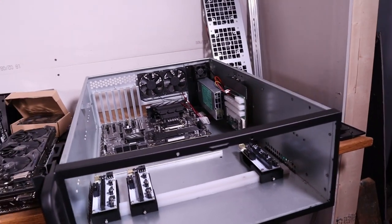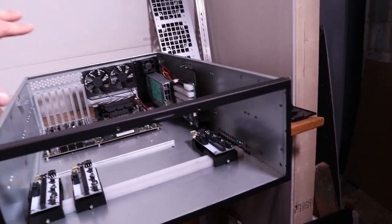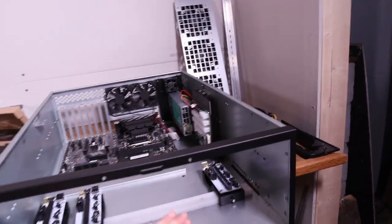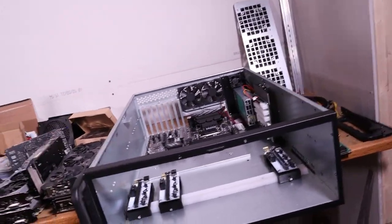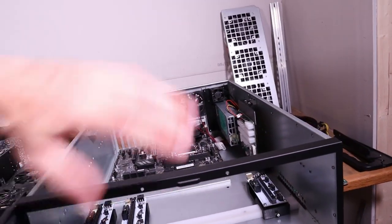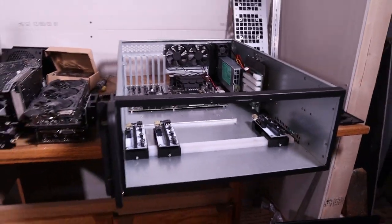Everything needs to be scalable, ease of access for preventative maintenance, and key-turn. We need to be able to rinse and repeat when we add a case. We buy a case and we should be able to bolt everything up — no drilling or anything. All these holes are stock in these cases. We're using stock bolt patterns to put in what we need, screw them in, place the risers, put the video cards in, mount the motherboard, mount the PSU adapter, mount the parallel miner bracket for the breakout board, put it into the rack, get it tuned in, and move on to the next one.